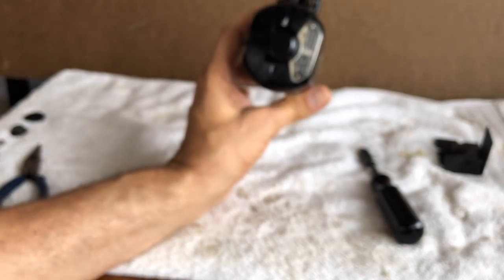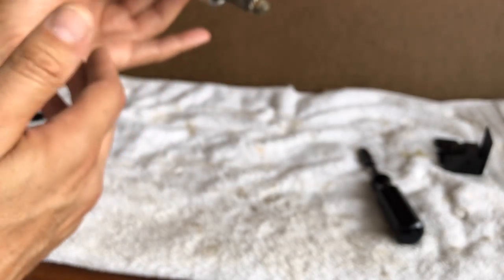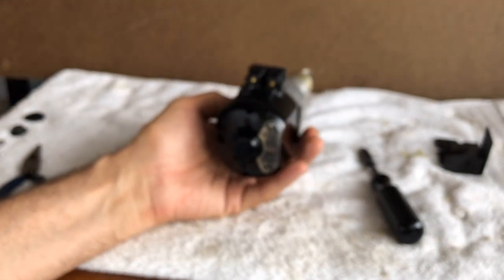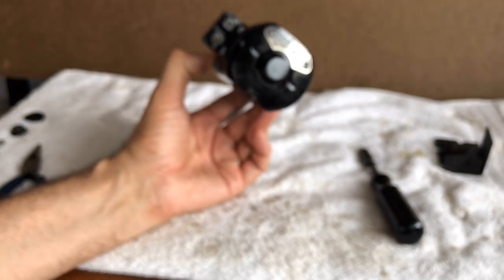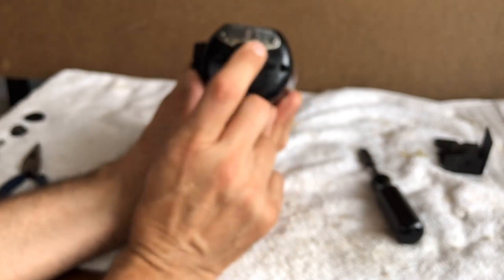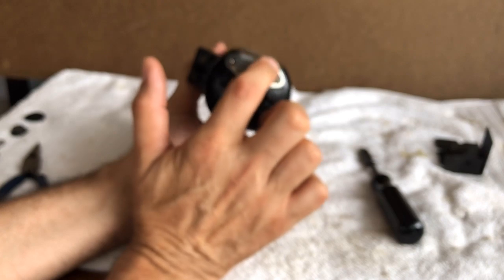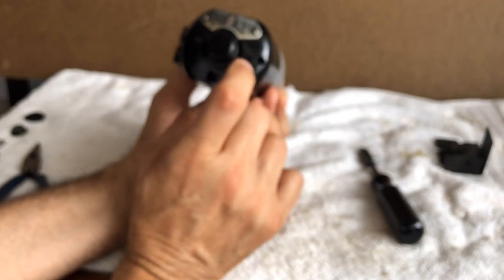It's a worm gear motor, but a very different design from the potted motor series. The first thing I want to do is get a look at the commutator and the brushes. To do this, there are access screws to remove. Note that the screws are on the end where you see this little plate — you may or may not have the plate here. It's going to be on this Bakelite plastic end.